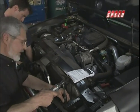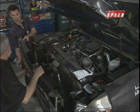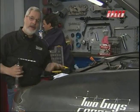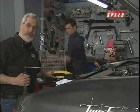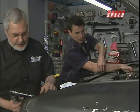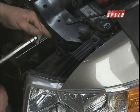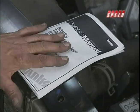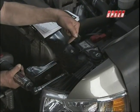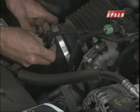The last bolt's coming out here — got those little clips out of the bottom. When you're taking this thing apart, one great idea is this little box with compartments in it. Every one of these screws is a different length and size, so you want to make sure you keep up with them. Besides taking the grill out, you've got to take a lot of parts including the headlight. Take the instructions and read them step by step — it tells you how to do it. There's a bolt behind the inner fender skirt too. Read the instructions — amazing how many people won't do that.